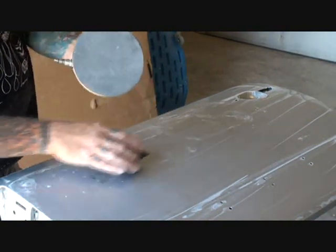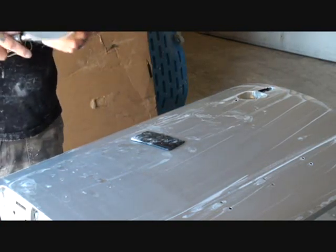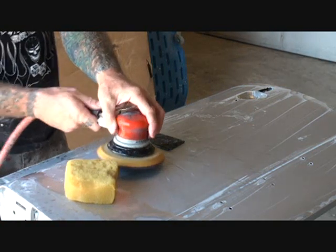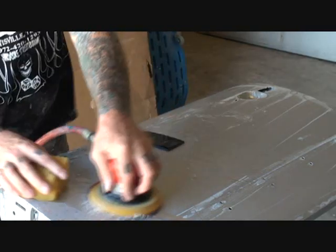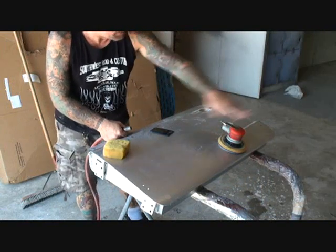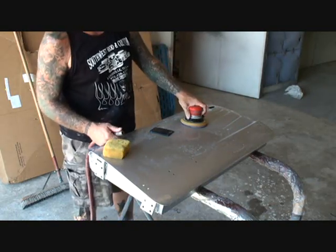Now I want you to pay attention. This is 2000 grit — you can hear that it's sanding my hand. Those go a long way; I actually used that on another car and kept it. These are very expensive as well. We're going to plug our sander in just like you see, then dip it in the water, get our sponge, and turn it on high speed. I want you to pay attention to the way that I'm going back and forth — I'm not going in circles or angles, I'm doing it very quickly and very uniformly.